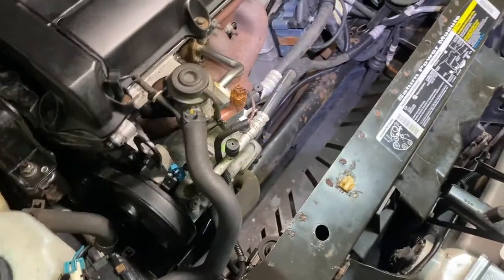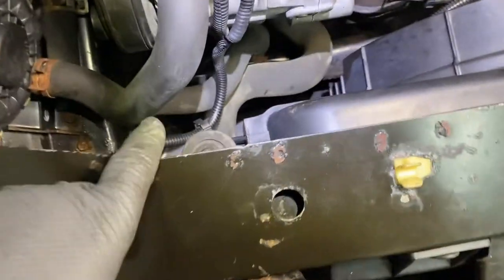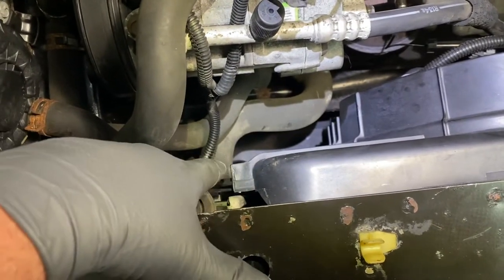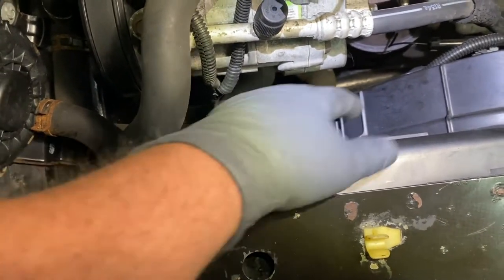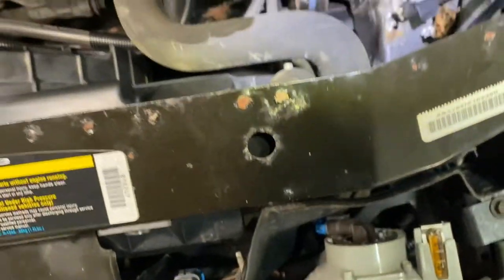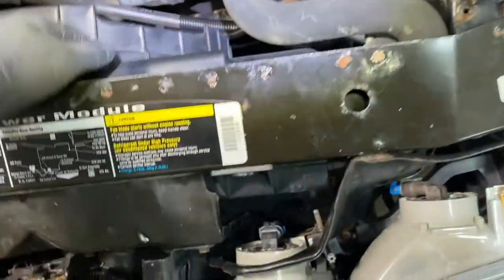It just slides right in. It has one screw over there, I believe. So before you hook up the bottom radiator hose, make sure you put the radiator shroud in there, because the little notch on the bottom will hit. So it's easy to do that before you put the bottom hose on. And there's gonna be one screw right here. That's one screw, and make sure it slides in on the bottom. It has a catch, so it doesn't flip around.